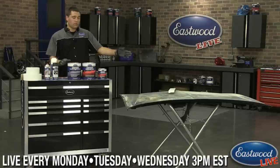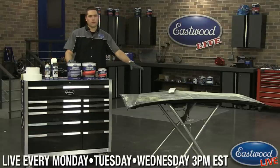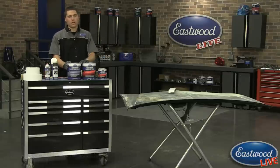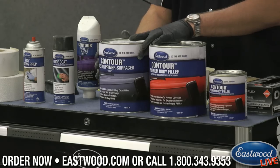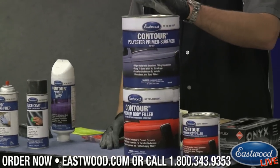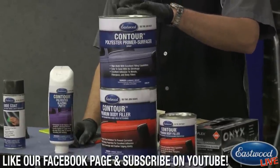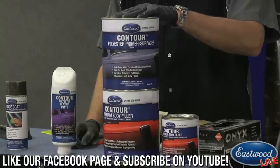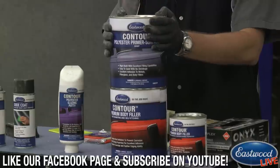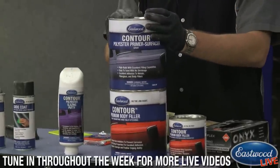Or the other option, when you've taken that up to 80 grit, say you have large sections. Say this hood has a lot of work because over the years it has seen a lot of abuse. The contour polyester primer surfacer is a great option, as it is essentially a sprayable version of this. So super high build. You usually want to spray around a 2.0 or a 2.2 tip, as it is a very viscous material. But since it builds so high, you can spray this. It is a direct to metal primer.